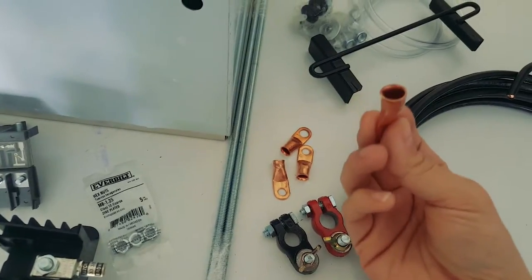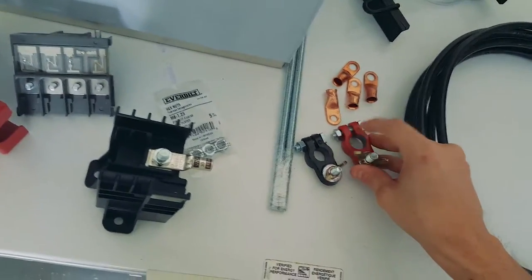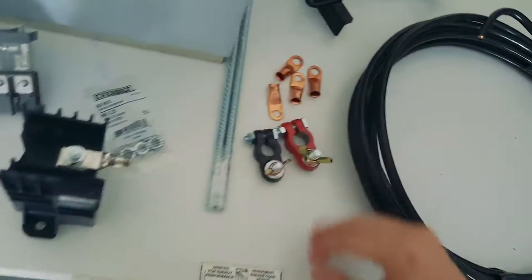Chances are I'll probably choose this side but I'll go a little farther back to allow me to open this up and fill it up with a funnel if I need to. But first and foremost, the prep work — I have the cable that I'm going to be adding the copper lugs to. I picked up some all solid copper 2-gauge lugs that I'll be using on the cable itself, and some brand new marine grade battery terminals, which are plenty for an automotive application.